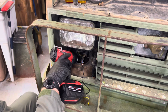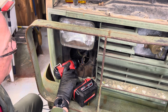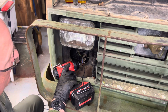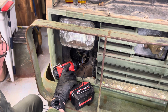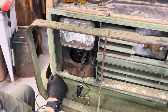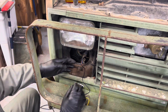You can see as I'm doing this — as the connection gets hot, it shrink-wraps around both wires and the solder in the middle starts melting, and it melts into the two wires. Don't touch it right now, it's hot. It's solid now.